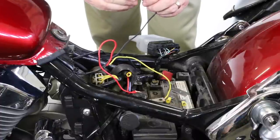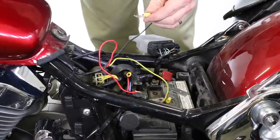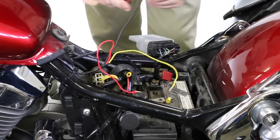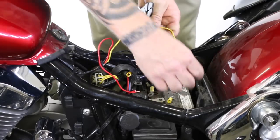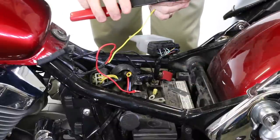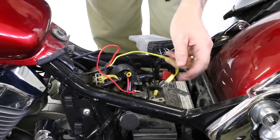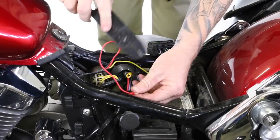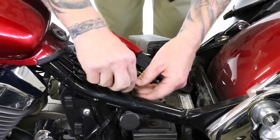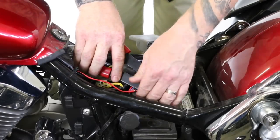What Ryan's doing here is putting terminals on the end of the yellow and the black wire — black wire is ground, yellow is hot, our red is our remote. We chose those colors because they match up with the stereo we're putting in. He's going to put those on — we're not going to hook them to the battery yet because we still have some wiring to do on the other end. Once he gets those two done, he's going to use the butt connector and connect our remote power in-line. It doesn't really matter which wire you pick as long as it turns on and off with the ignition switch.